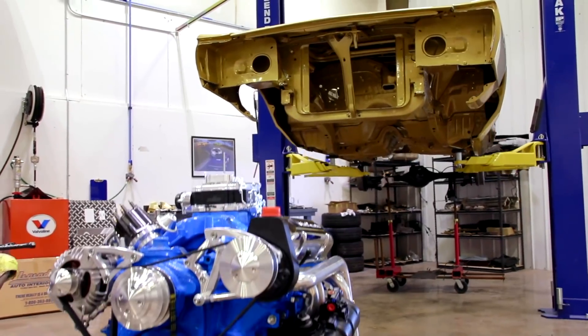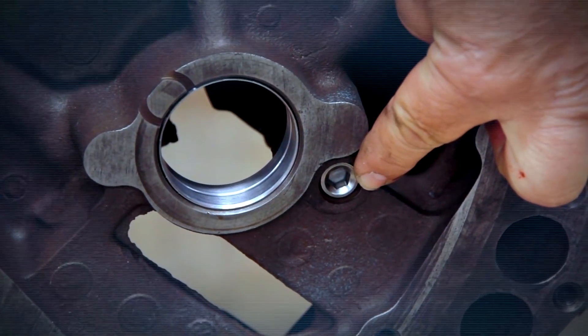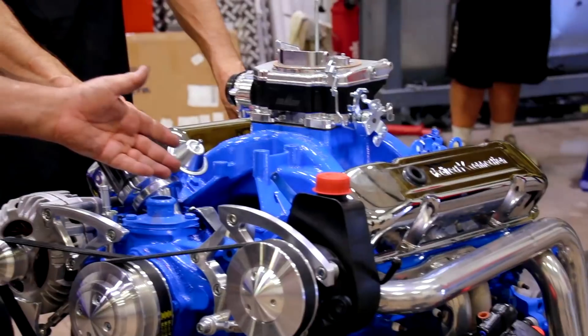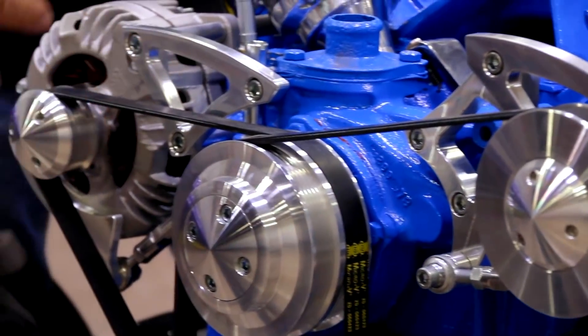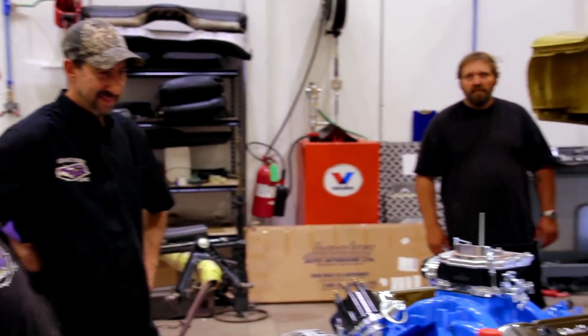Right now, we're getting ready to install the 400 Magnum 4-speed in the 1972 Dodge Charger SE. Everything's laid out, rounded up, detailed — there are some aftermarket parts on it, and we're ready to go. This is the engine that had the failure with the oiling problem — the guy had left the galley plug out of the front. Such a simple little mistake ends up tearing an engine apart to make sure. But everything looked good inside and the rest of the engine was built out right, so we just put it back together and detailed it up. 72 corporate blue is the correct color, even though the Edelbrock high-rise aluminum and the Holley Demon carburetor, chrome valve covers, headers, and serpentine belt are not factory. But it's cool — it looks really good.